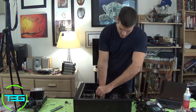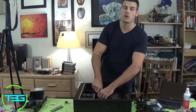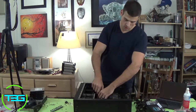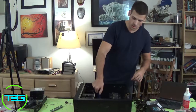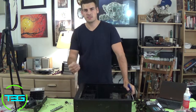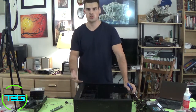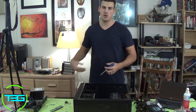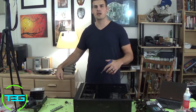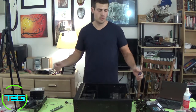One thing I did not mention, guys, and there's quite a few ways to do this. Actually, Linus went over it on his tech quickie, so if you guys want to go check him out. But make sure that you ground yourself before working on this. If you have carpet in your home or somewhere that you might get a lot of static electricity, and you know that anytime you go for a doorknob, you get zapped, make sure that you're grounded. There are wristbands you can get that you can put around your wrist or around your ankle and hook to a metal object, and that'll get you grounded so you don't have to worry about it.